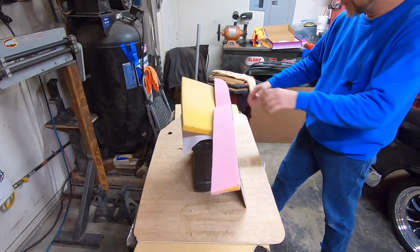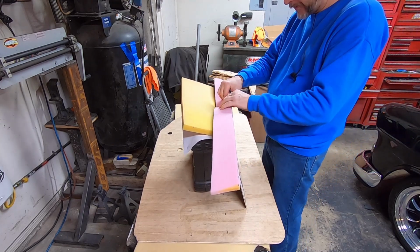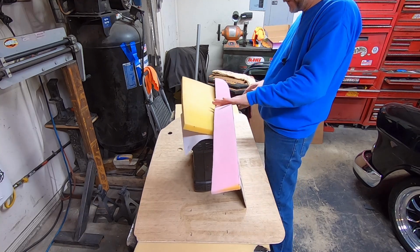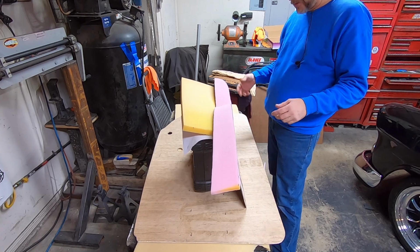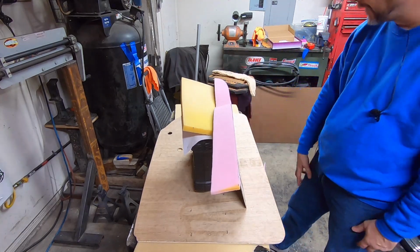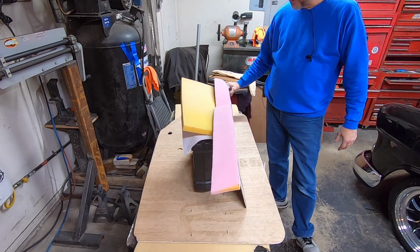Ashtray delete. I tell you, man, sedans are way easier to upholster than hardtops. Actually, sedan is just straight around, all around an easier car to restore, in my opinion. The weather stripping doesn't have molded ends on it for the doors. Your door panels and rear side panels are just flat. You don't have none of this intricate stuff. The back seats are easier to wrap for when you put your cover on. You don't have the notches in the corners and stuff, so.